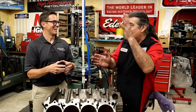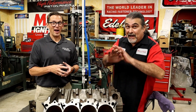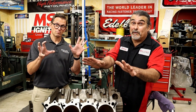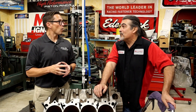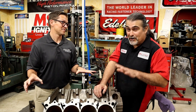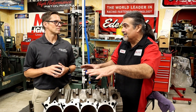I love the beehive spring — it's a different world now. You don't need that much spring pressure anymore; in fact, you want to get away from it. I don't know how much horsepower is locked up in those springs, but it's going to be a bunch. A long time ago all we cared about was high-RPM valve float, so we put as much spring pressure as we could — overkill on everything. That's actually one reason why those old engines were down on power: those big monster springs on the valve seats, turn the motor over and it killed power.